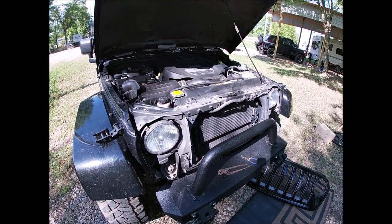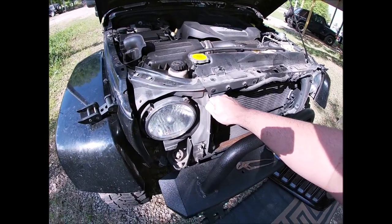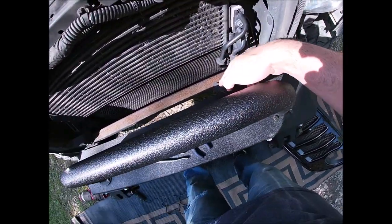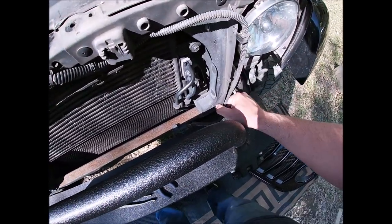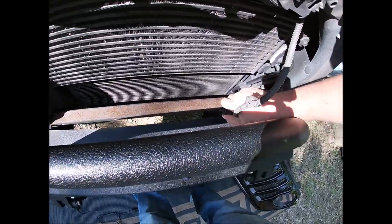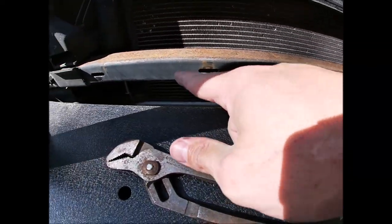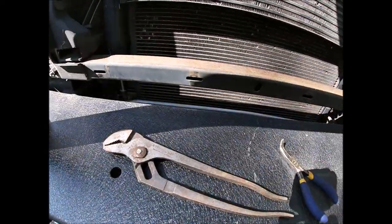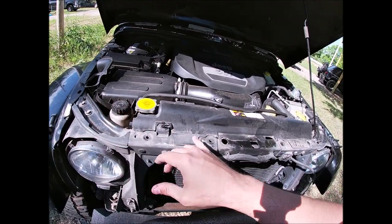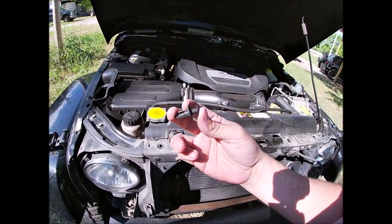Once you take the stock grill off to put that JL grill on, I think we're going to have to cut these two fins right here. You've got a fin right here, right here — and this is just your ambient air temperature sensor right here, which can just be pulled off and put somewhere else for the time being. Now the clips that go in here don't line up, but I'm hoping this is slotted enough for a couple of them to line up, and I'll cut the rest off. If I can get about three of them to go in, we'll be fine. We may have to drill some more holes to put these body pins — they're just body pins, so I should be able to manipulate them.